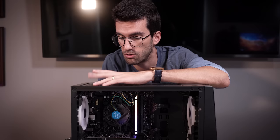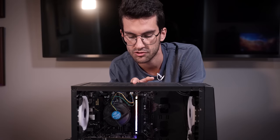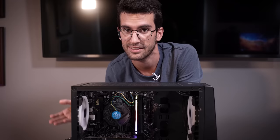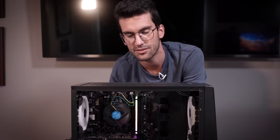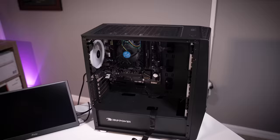I'm going to try moving this DDR4 module to one of the outer two slots on the different channel, because if we have a dead memory channel it could be the reason why we're not getting a picture on top of the bent pin — which would have caused the system to reset the way that it did. Nope. Once again in this repair, we are either back to the motherboard or the CPU.